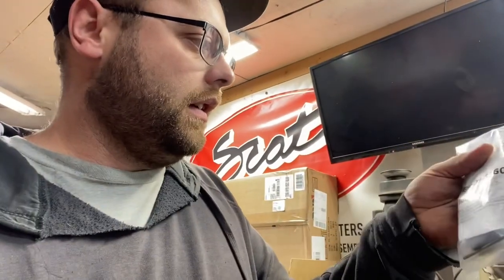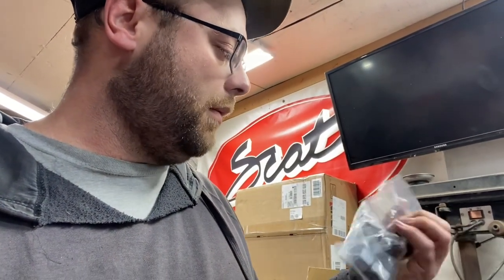Here is the other switch panel that you can put in any vehicle — that's part number HND-2. Also, if you have an older transmission that runs a cable, here's the part number SEN-01-4160. That's a speed sensor with cable, so it's just an adapter that goes in between the cable and the transmission.